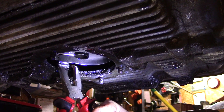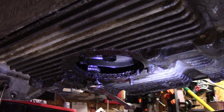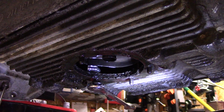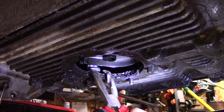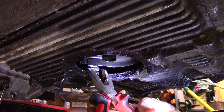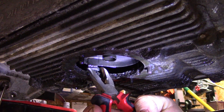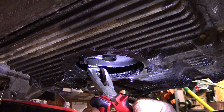That's about all it'll take — it won't go anymore. What's happening is the lock nut is contacting a little piece of metal on the pickup tube. So I'm going to put the stud a little further up into the case with a ratcheting wrench and go back to my pliers game, because this has got to be fairly tight. It's going. It may have reached its limit, so I'm going to hold pressure against the nut and the pickup tube with the pliers and use my other hand to start engaging the stud further up into the case to tighten it down.